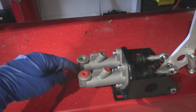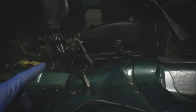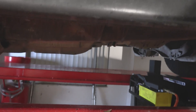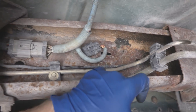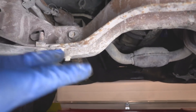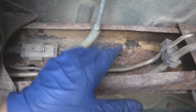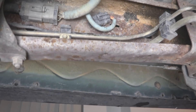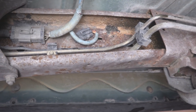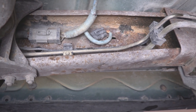This is our hydro e-brake right here — one fitting is the inlet, one is the outlet. I'll crawl underneath and access the brake line. This car has two dedicated brake lines up front — one to the front right, one to the front left — and this brake line goes to the rear and controls both rear wheels. So we only need to tap into this one. When we pull our hydro e-brake, it's going to pressurize this brake line, locking up both back wheels. First I'll drain the brake system by cutting this line and capturing the fluid, then tee off and reroute it.